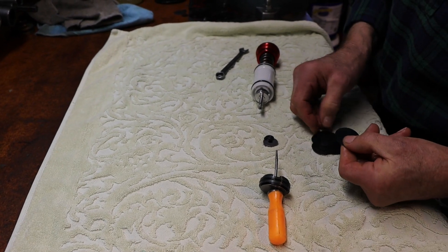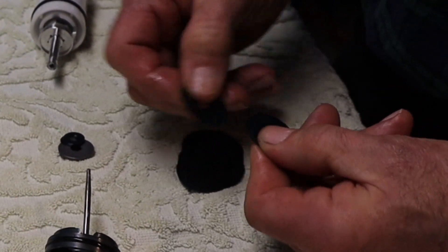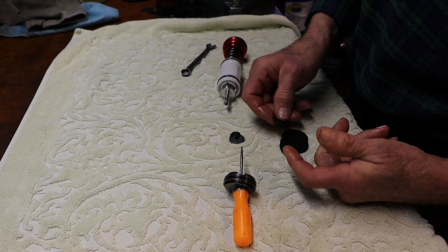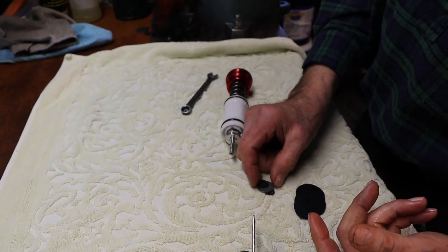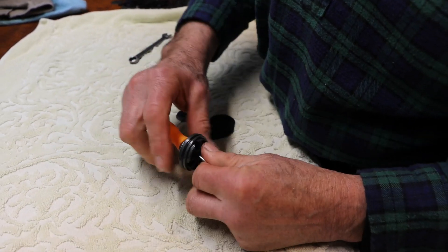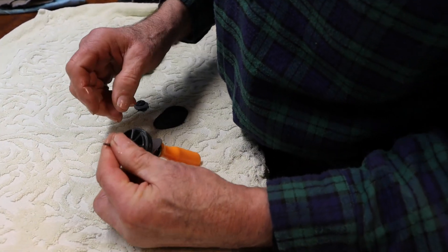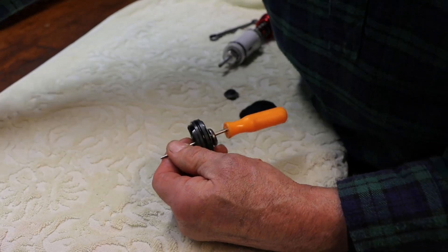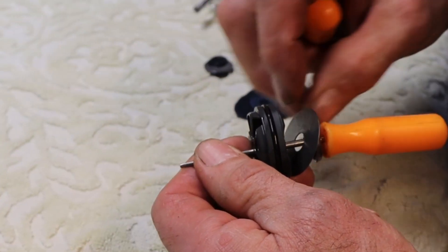We have a number of shims of similar diameter and start to reduce in size, the way a leaf spring would work. The size of the last valving shim is what we call the pivot, and that's very effective. When we are compressing the fork, the oil is being forced through there, opening this check valve.